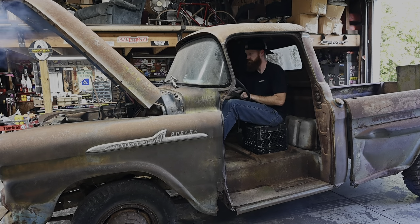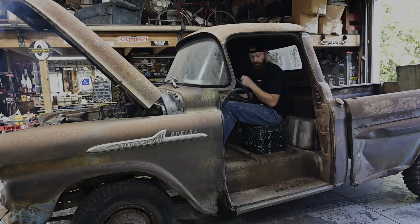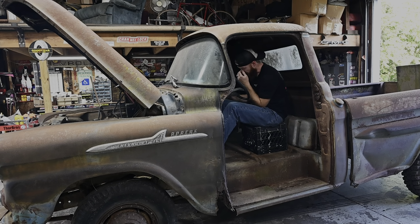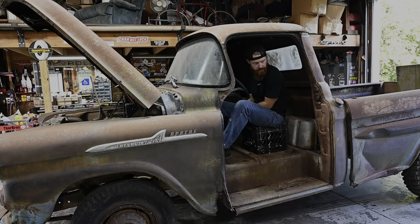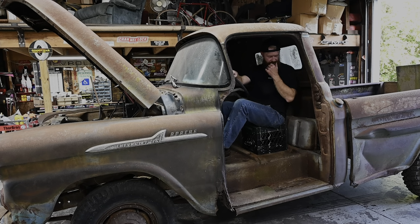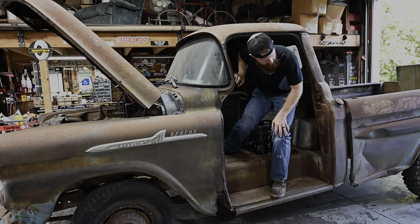Well, we don't have any gear still. I'm saying that clutch is just smoked. And I seen a comment, somebody saying it's popping, probably because we got a valve sticking. And that's very possible too. Well, positive news, I seen the oil pressure gauge was up. I don't know exactly what all these little bars are, but we were over halfway. So we do have oil pressure. And it looked like we were charging. That's a bummer though, man. I was hoping that was going to take care of our clutch issue.